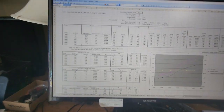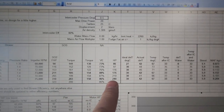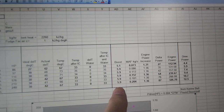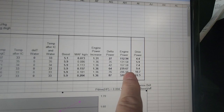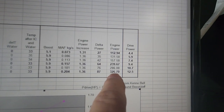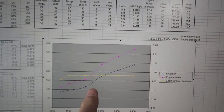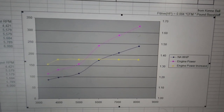I did a quick spreadsheet analyzing this — I'm a retired engineer, so I overanalyze everything. I put in the blower map numbers, the stock Honda numbers, and intercooler data, and calculated delta temperatures, how hot the air is going to be, how much boost I get, mass airflow, and engine power — roughly 240 to about 330 horsepower. It also shows how much horsepower the electric motor needs to generate. I'm not claiming it's all perfect, but it gives you an idea.